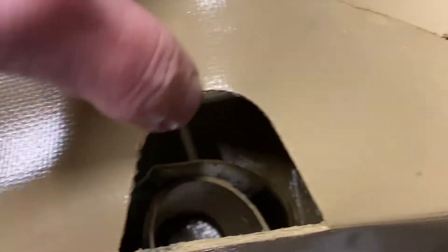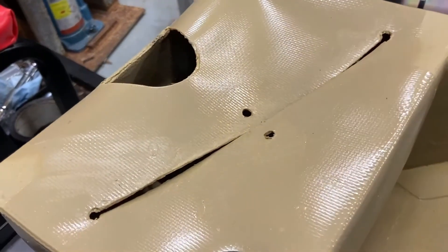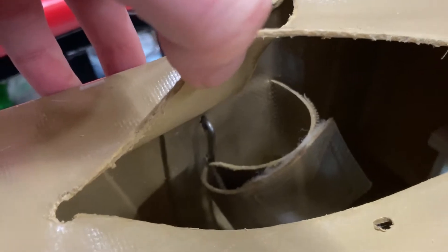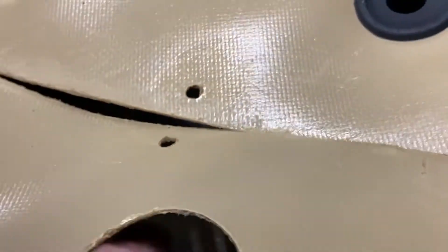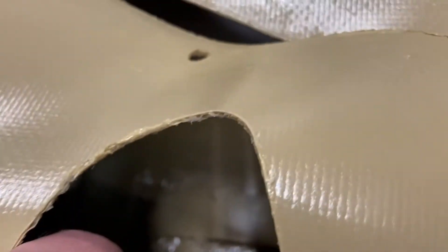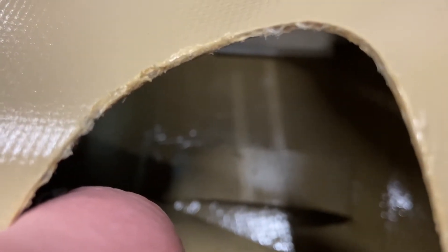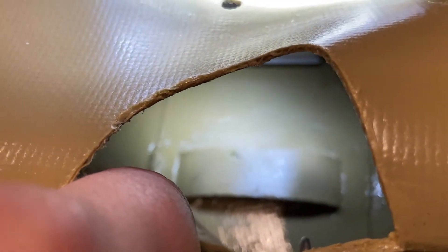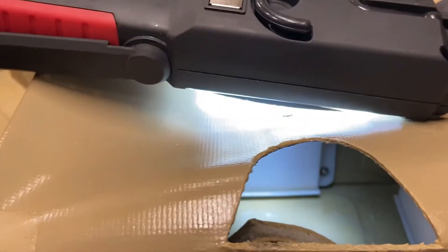The pump sits in there in that velcro strapping. That velcro strap holds the fuel pump in place — it loops around that stainless steel buckle at the back. Within there is another little strap — I'll try and put the torch on it to help. That little strap there is where the sock fits under, just an extra way of locating the pump. Again another trapdoor on this side, and that's the back side of the trapdoors there. That's the one at the front obviously.